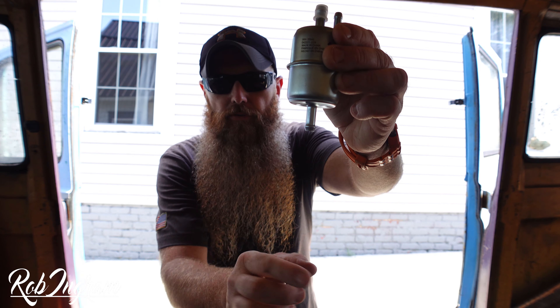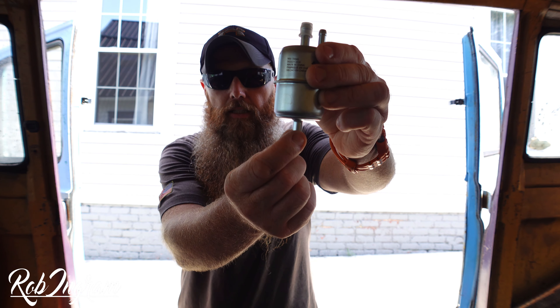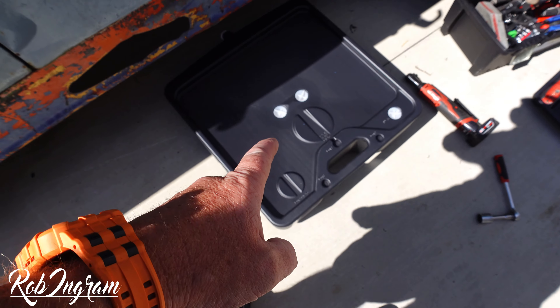So what I'm going to do is use just a gas can as a temporary fuel tank. I'm using an electric fuel pump — this Edelbrock. Any items you see, I'll put a link down below; almost everything comes from Amazon. I'm also going to hook up this fuel filter, which has one input but two outputs. Gas comes from the fuel pump, goes through the fuel filter, one outlet goes to the carburetor, and one returns back to the temporary gas tank. That way I don't need a pressure regulator — it solves all my problems, and these things are really inexpensive.